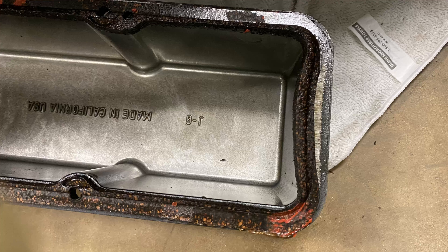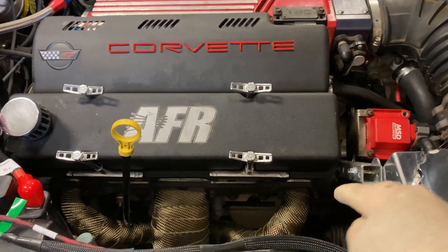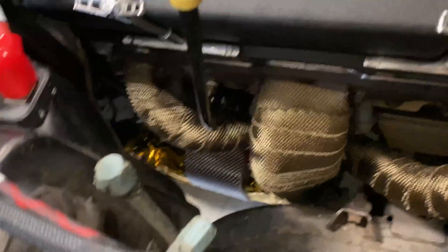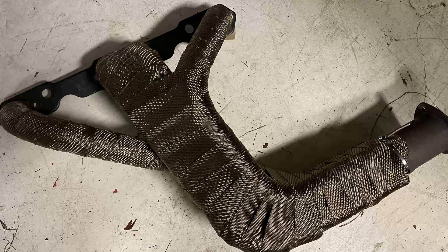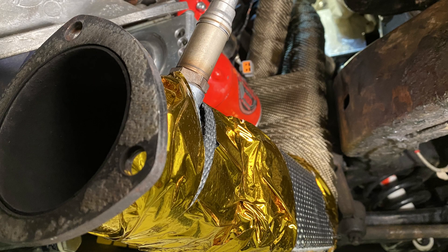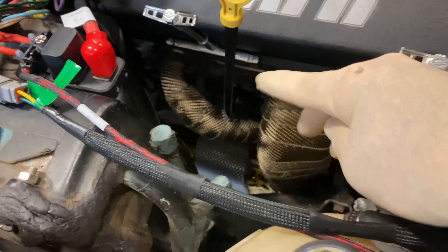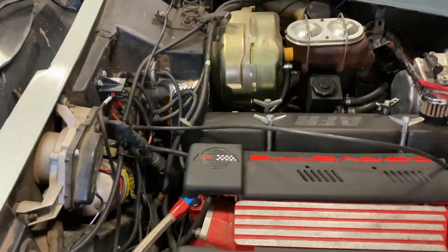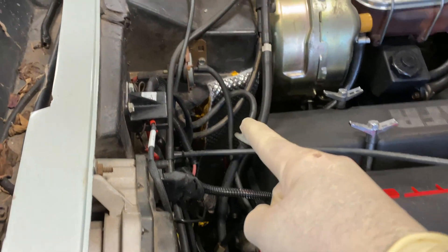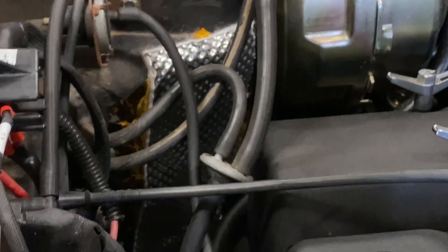Hopefully fixed — I have a new rubber gasket on this, and heat wrap down below. When I was filling the transmission back up because I was working on the throttle cable for the transmission, I immediately spilled a little bit here and it went straight down — thankfully onto the metal sheathing I have — and it didn't soak into the wrap. So I have heat wrap. This previously had aluminum foil there because it's two open holes. There's now a more robust cap right there.